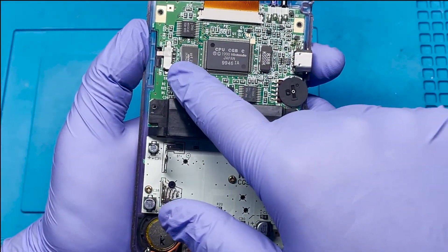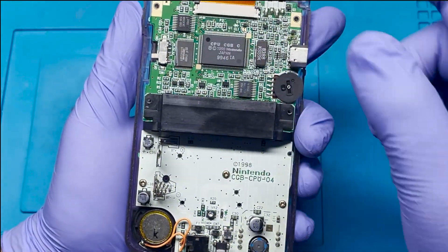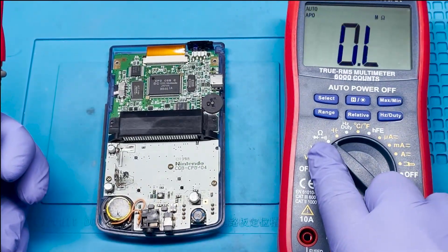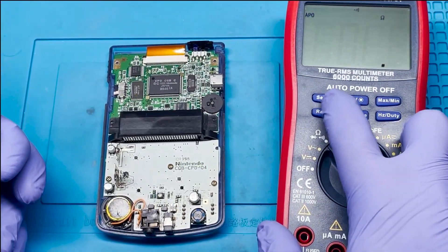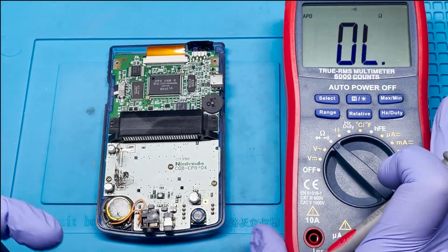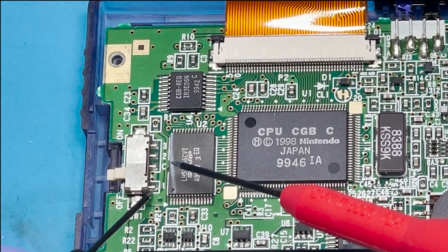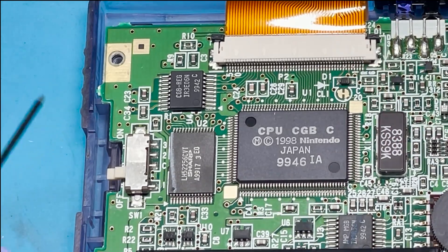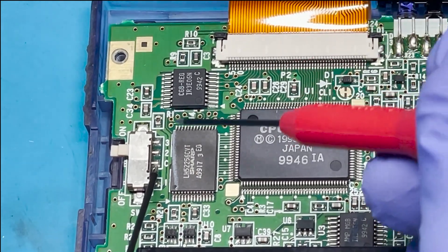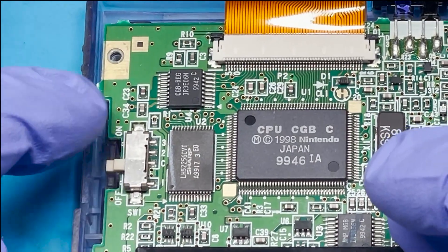I'm going to go ahead and test out the switch to see if it's bad. Sometimes it just gets sticky and we're going to go ahead and test that. Everything's working fine on that. So I'm going to get my multimeter and I'll go ahead and show you. I'm setting it to continuity mode. If you test on the off position, one and C should have continuity and we get that. Now we switch it to the on position — C and three should be in continuity and it is. So this switch looks like it's working okay.